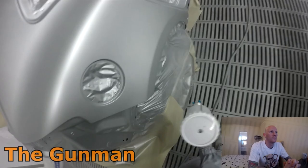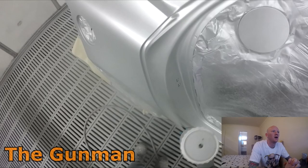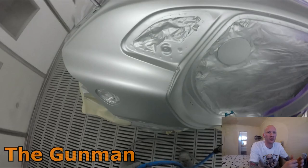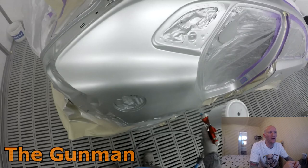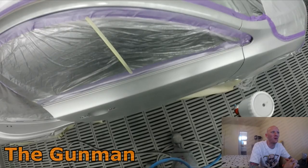Water, that was a bit of a pain in the ass in winter, you know. You'd have to come out and then wait, get the air blowers on it. The application technically was a little bit quicker, but you'd lose it in your drying times. And literally, once I put the base coat down, I'll go out, clean the gun out, mix my clear up, put it in the clear gun, come back in, you're right to go. You might have to wait a few extra minutes in the middle of winter.